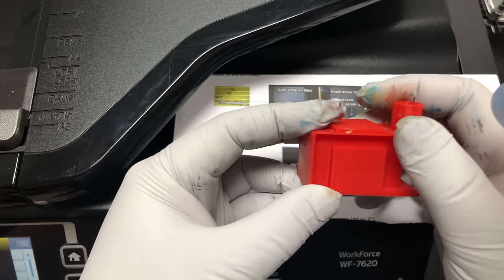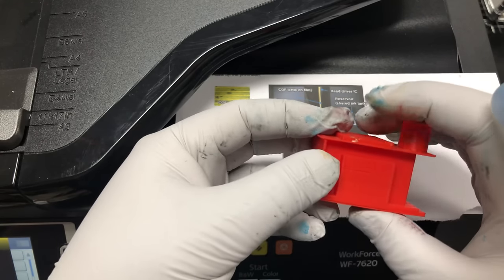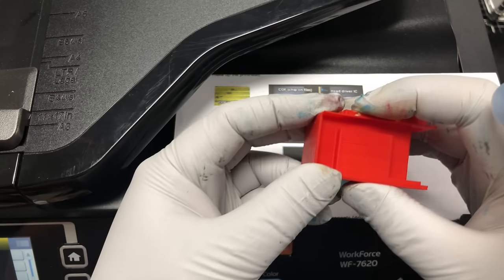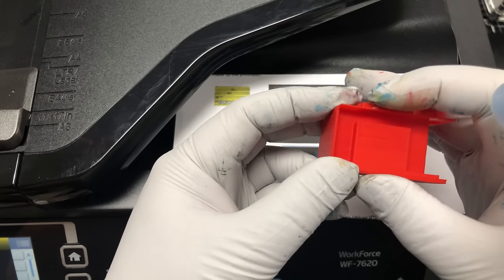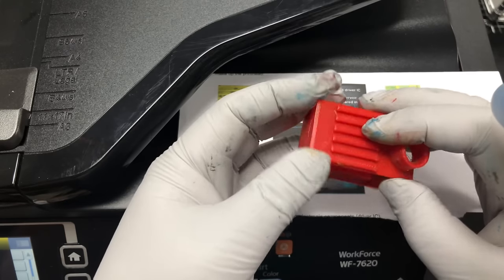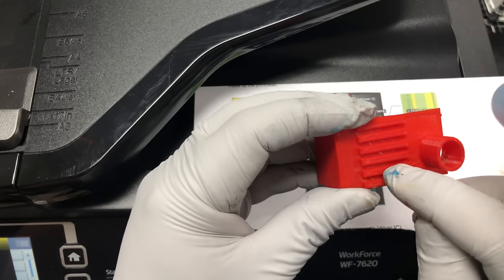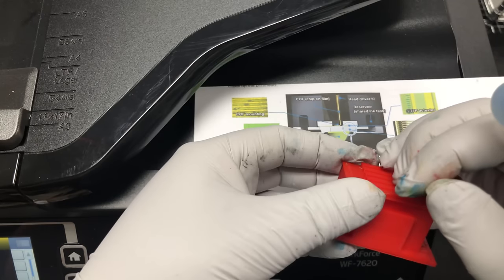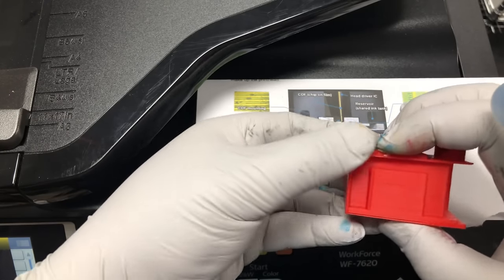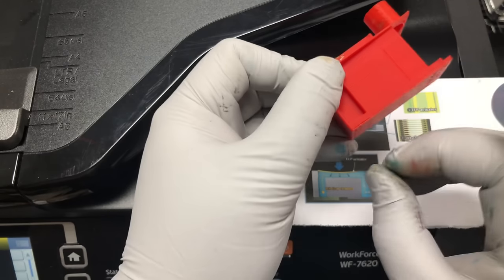The second thing is called a thin film piezo, okay. So you have a really thin film here, and then there's a piezo material, which is a chip. So when you have electricity, this thing is going to expand, and therefore it squeezes. So you get a psh. And when it squeezes this tube, a little droplet comes out. And the printhead has a series of tubes, of ink channels. Then it has all those little pixels, and then they come out with a wire. So they're just like playing a piano, they squeeze each one, and then there's a tiny hole, which is the third thing called the nozzle. The nozzle is going to squirt a little ink droplet out.